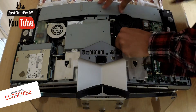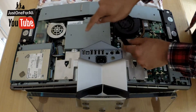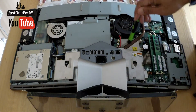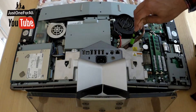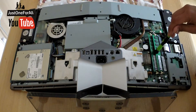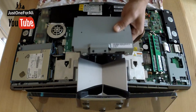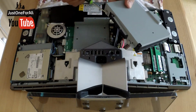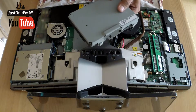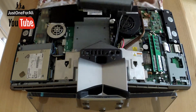What I've noticed is if you take this cable off, it gives you a potential — what could you do? You could put a caddy in here to hold and actually put an SSD drive in there, and that would be brilliant. At the moment there's a dual core in this PC — you could put a quad core in there. There is a CPU upgrade you could do. I wish you could take the RAM up to 8GB; that would have been absolutely fantastic, but it doesn't look like you can. So if you wanted to upgrade the hard drive, there are four screws to undo so it comes away from the caddy. You could put an SSD drive in there, but you'll need a caddy adapter to go from 2.5 inch down to fit this caddy. It can be done really easily. So if anyone's thinking about putting an SSD drive in the XPS and making it faster — you can, it can be done.